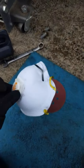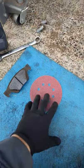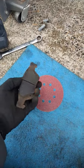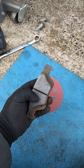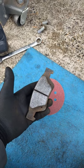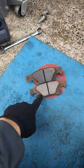You want to wear a mask — brake dust is no joke. Then with your heavy grit sandpaper on a flat surface, you just take your brake pad, rub it back and forth taking off that top glazed layer. When you're finished, spray it off with brake clean, and voilà — a fresh new surface for your brand new rotors.